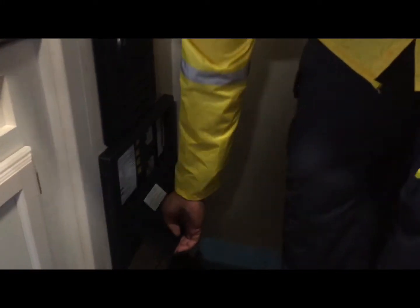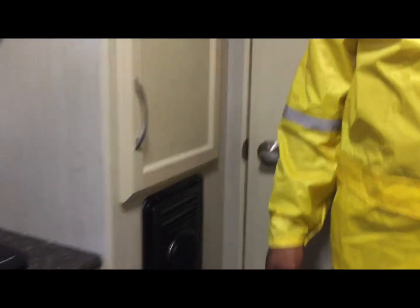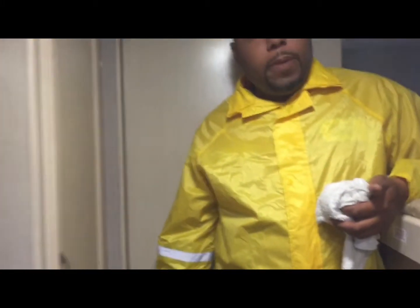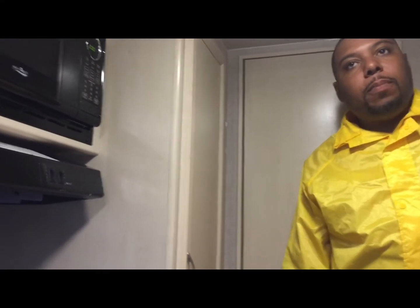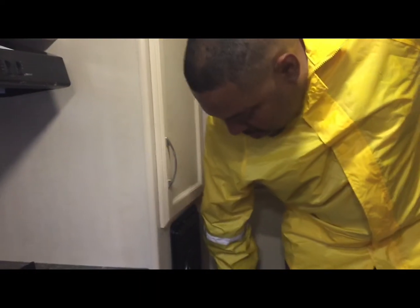Come on. Breakers in your fuse box. Everything on your household breakers is everything that's running off the shore power. All of your automotive fuses are everything that's running off the 12-volt battery power. We do recommend buying a pack of multi-fuses. You can find it in any hardware store. And the cool thing about your breaker box is you have LED indicator lights on your fuses. So if you happen to blow a fuse, a little red light is going to appear next to it, letting you know it's blown. I'm so glad you knew how to do all this stuff for me. Fuses, got it.